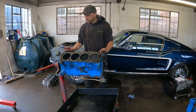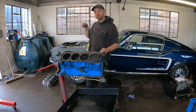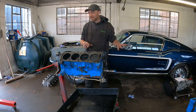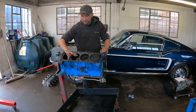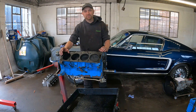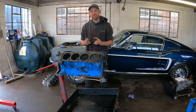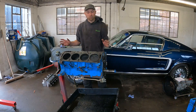But overall I think we've got a handle on it. It hasn't scored where the hydraulic lifters sit. I think if we tried to pull that out upwards where the end was mushroomed over, that would have made a real mess of the channel where they sit, because it's a machined surface. So by taking the cam out and letting that drop down, I think we've saved the block. All the bores look pretty good — you can still see the hone marks, there is just a little bit of a lip at the top. But the main thing I can't get over is how big everything is. The cylinders, the pistons — absolutely massive compared to what I'm used to working with. And the same with the cylinder head — because there's just two valves per cylinder, the inlet valves are absolutely colossal. So it's always pretty cool to work on something new.